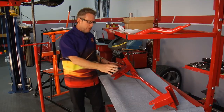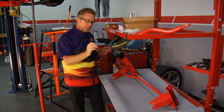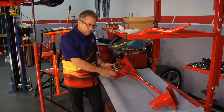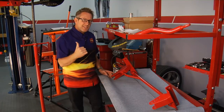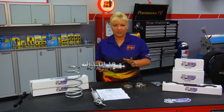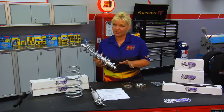Now it's time to mount this rear crossmember. We're going to put it behind the rear end, mount it up in the chassis — it's going to take some time. We've got to drill some holes, take some measurements, and get it right. We're going to mount our shocks off of this, and we're also going to use the Watts link. We'll mount it off these on each side, so it's going to take a little bit of work.